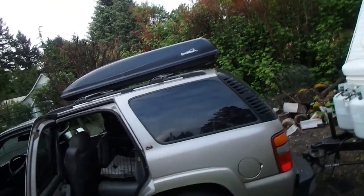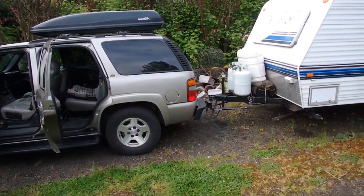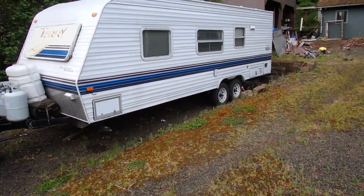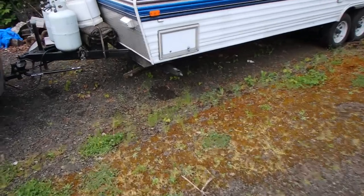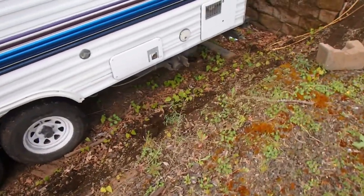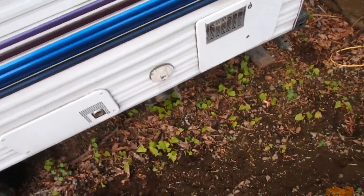Okay, everybody, everything is set up, including the cage for Simon the Pug. We can't forget Simon. It's all about Simon. So his cage is set up, ready for him to travel. Tahoe's up. See, it doesn't sag very much, but there's not very much weight on this thing either. All the blocks are up, the chains are hooked and crossed over, wheel chocks are gone, the power, oops, I've got to close this, part of the walk around. Always do a walk around before you leave.